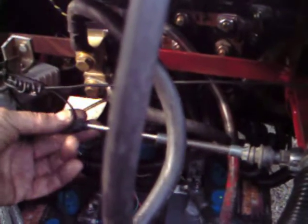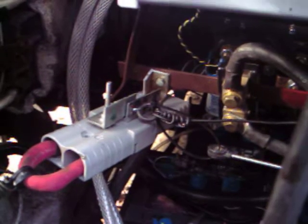We've got two handles, two ways of pulling it. One is the automatic transmission shift linkage — there was an automatic transmission in here. You can use your heater duct work movement, or a clutch movement, whatever movement you want. It goes inside and it's right on the steering wheel. We used the park, drive, one and two positions, so when we put the linkage in one, it'll pull on this. We also have another wire that goes to the outside with a little handle.